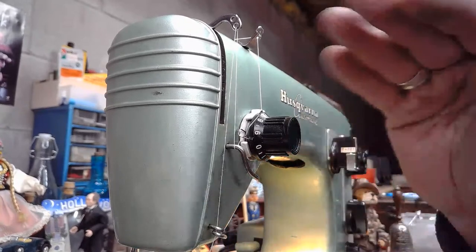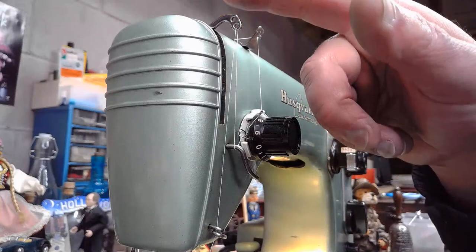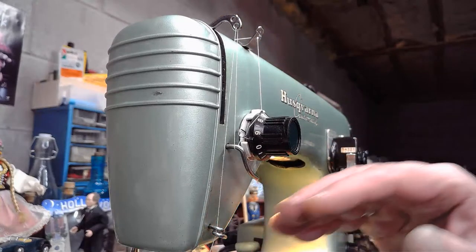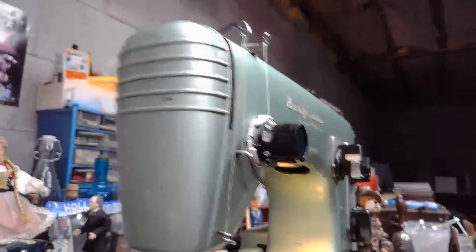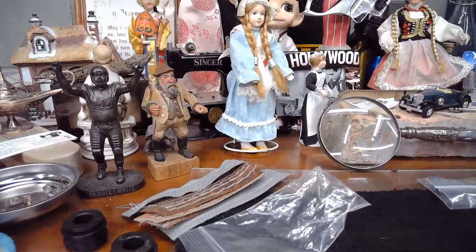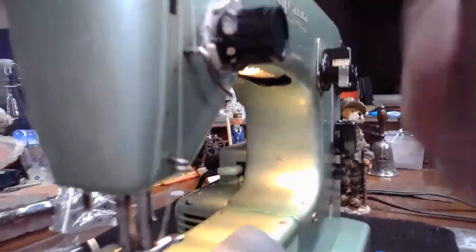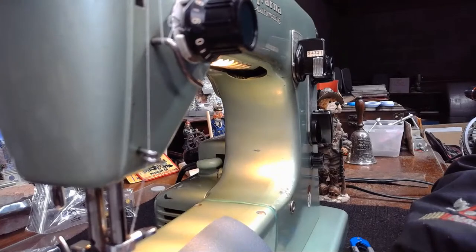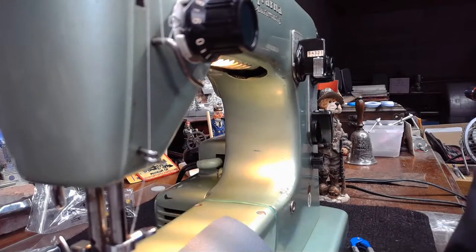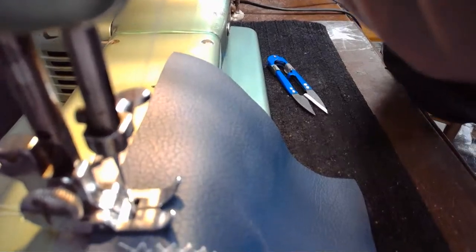So for 99.9% of the lock stitch machines like this Husqvarna, the highest position for the take-up arm is going to serve you best, especially if it's starting to go into that downstroke. For some chain stitching machines, even like this old Singer Model 20 in the back over here, the black one, just behind our Swiss gal and in front of Umi and her buddy, you actually launch better if your take-up arm is at the lowest position. I'll demonstrate that when I do a premiere for one of those machines. That way you know and you're familiar with that. But Emma was absolutely correct. We want to have that take-up arm at the highest position, and then we're ready to launch. So let's launch.